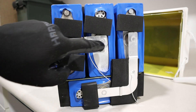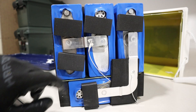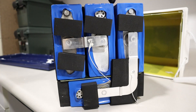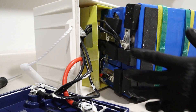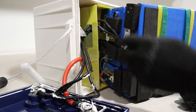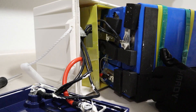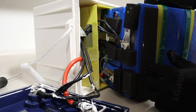Look at these bus bars — they are super thick and laser welded on the positive and negative terminals. You have BMS leads that sense the voltage of each module. The cells have spacing between each one with padding and they are compressed together. It's hard to pull the battery fully out because the fiber box inside is glued in, and the BMS is attached on the side. The main negative and positive leads are visible, but the negative one appears loose.